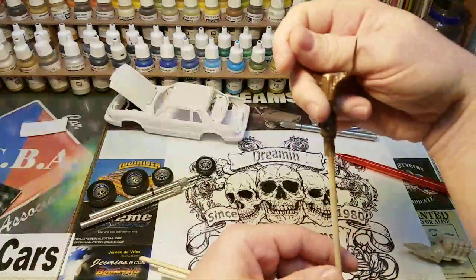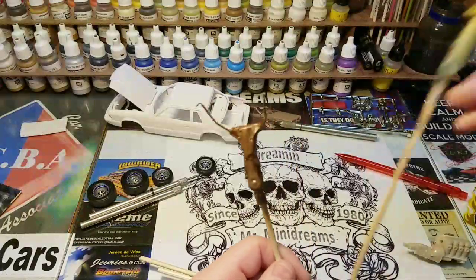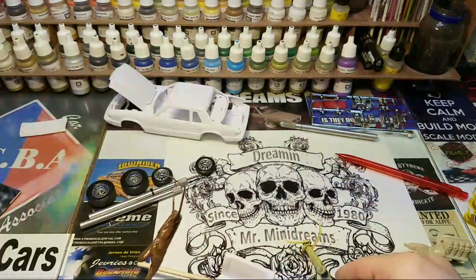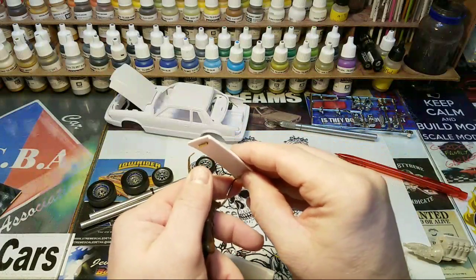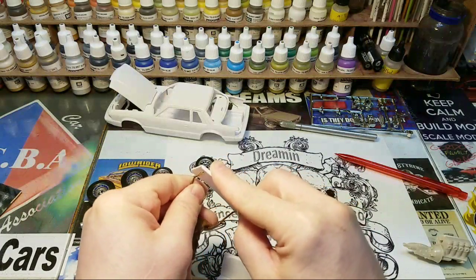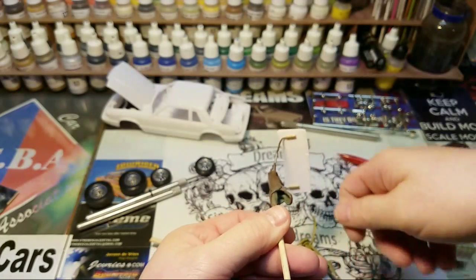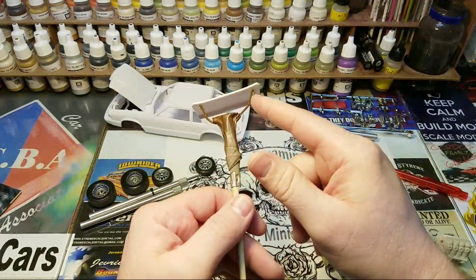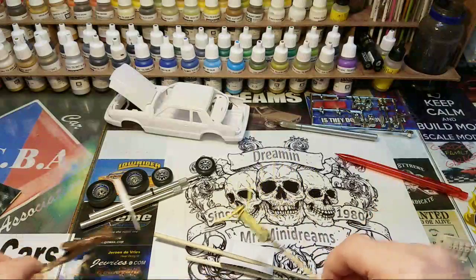And then what I also did is I got the same wire I used to do my hinges. I make two paint sticks like this. And what this is for is when it's time to go paint, these fit right into the products that I use to hinge the hood and stuff. And now look, it holds the body panel, so that way I can get in there and paint it, and it covers the holes so my rods can come back in, and it holds the product that I need painted.